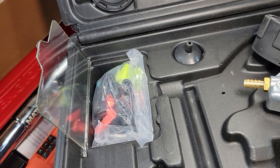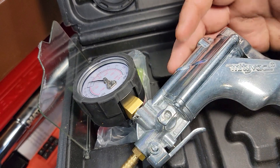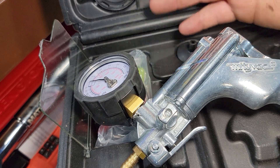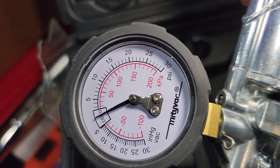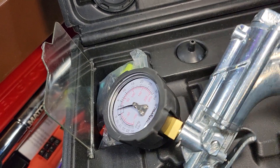I see all sorts of contraptions out there - guys saying they spent a dollar on a machine - but this tool is such a multi-use functional tool. For testing wastegates on turbos, especially diesel stuff, you can pull vacuum on those and make sure your wastegates work. Seven pounds of boost - this thing will literally go up to 30 PSI, so you can test a lot of wastegates, and it pushes 30 inches of vacuum.